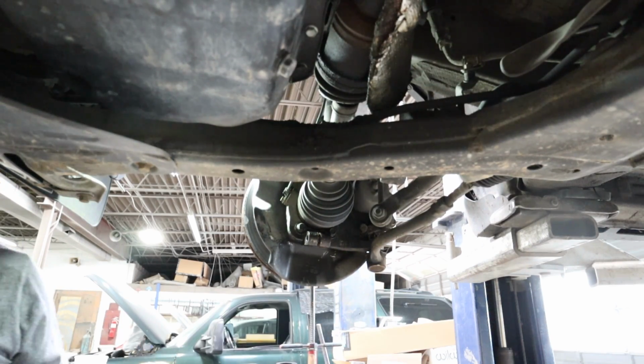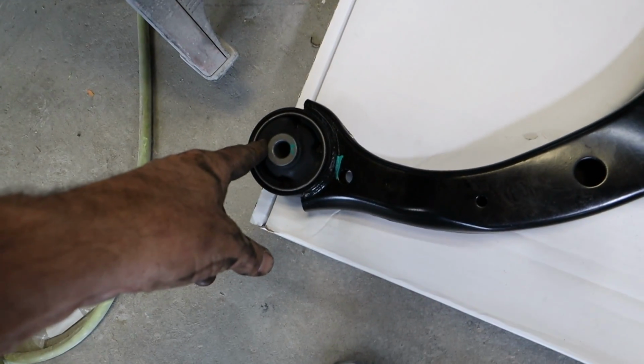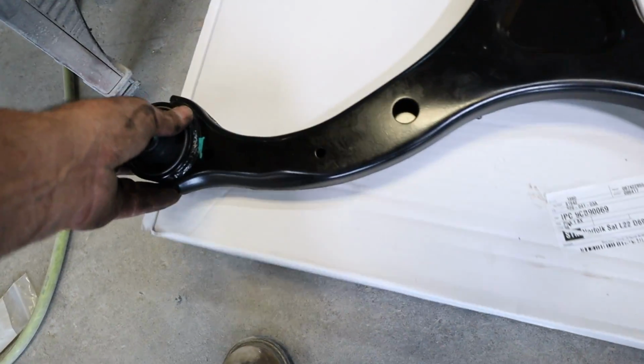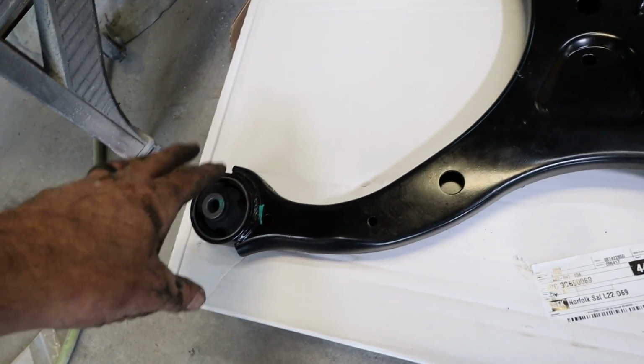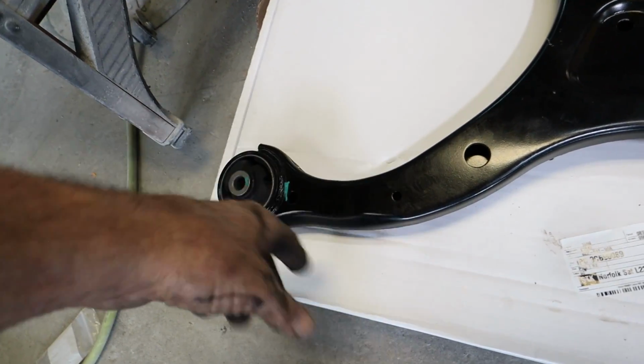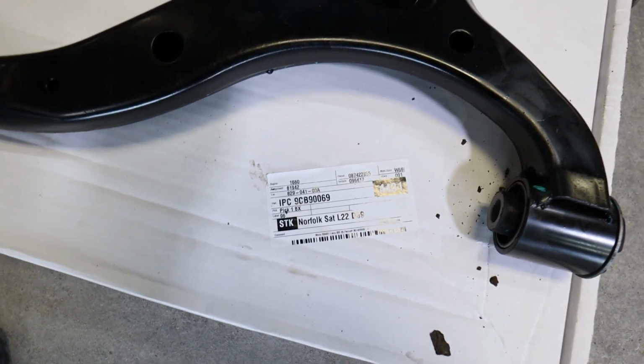Holy crap, Batman. These ball joints, like I said, they are replaceable, but the front bushings were gone on both sides. So that's why I recommend doing the whole lower control arm. Because if I did that, literally she'd be back in six months to do the control arm because they were bushings that go bad. The part numbers are 4431. There is a right and a left.